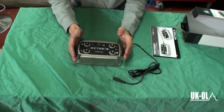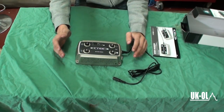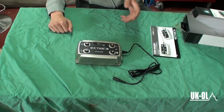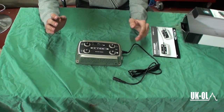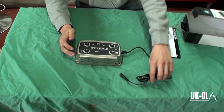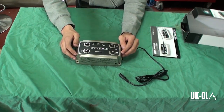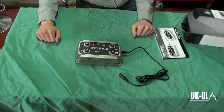This unit is best suited to modern vehicles, because modern vehicles are moving towards low output alternators. On the Hilux, for example, it will only kick out a maximum of around 13.7 volts, which is not effective enough to charge what is effectively a large battery bank. It will charge your original starter battery quite effectively, but if you start adding more demand onto the electronics and bigger batteries, your alternator simply can't keep up. That means your batteries will either die prematurely or won't receive the correct charge they're meant to have.